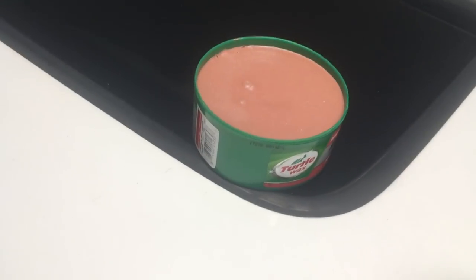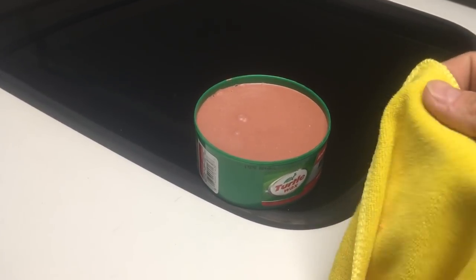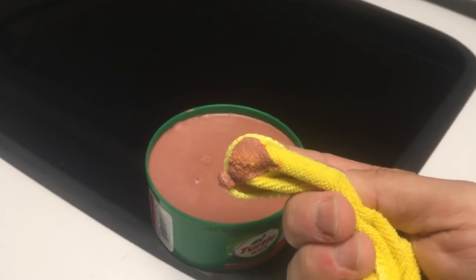There's my other one too — we're going to buff that out. I got my buffing compound and a clean microfiber cloth. It's important that it be clean; microfiber is the best. I'm going to get some compound on the cloth, roll it around, and work this in doing everything in circles. I'm looking to go over the entire area — it's okay to overlap into some of the other paint, this is just going to help buff it out. I'm applying medium pressure, not extremely hard but also not just lightly rubbing over it. Getting it in and around, working it in.